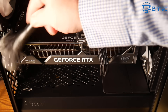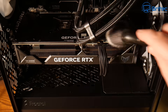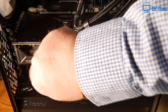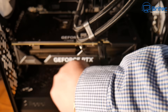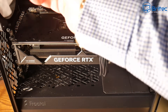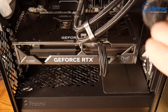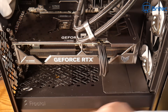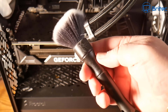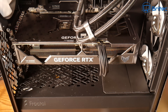These brushes here — you can get these on Amazon — are anti-static brushes that help agitate any dust build-up in the fins. It's important to make sure all of the fans and fins are dust-free because this is what helps dissipate heat on your GPU and also on the radiator. You can see the dust falling down onto the bottom tray, which is why I normally do this outside. These can be bought pretty cheaply and it's worth getting them.